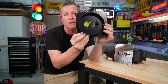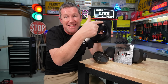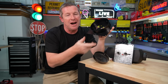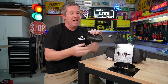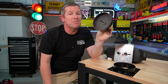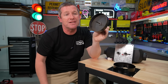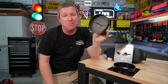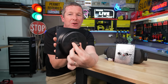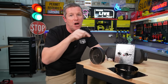Now, I think this is the best solution out there, but the one thing I've come across is that this on mine is around 130 millimeters in diameter. Now, the problem you'll come across with those is that most hole saws that you buy from Bunnings or anywhere like that, I did find some hole saws on Amazon, so you might get pretty close to the actual penetration size, are around 127 millimeters, which you'll note is a little bit smaller than the collar we're installing this into, which does become a little bit problematic, but I've actually used a jigsaw to open up the hole.